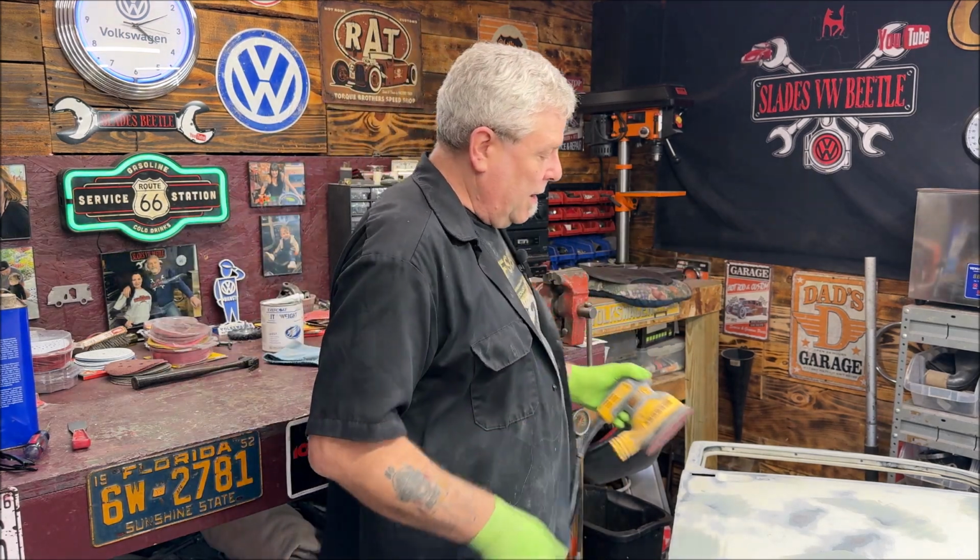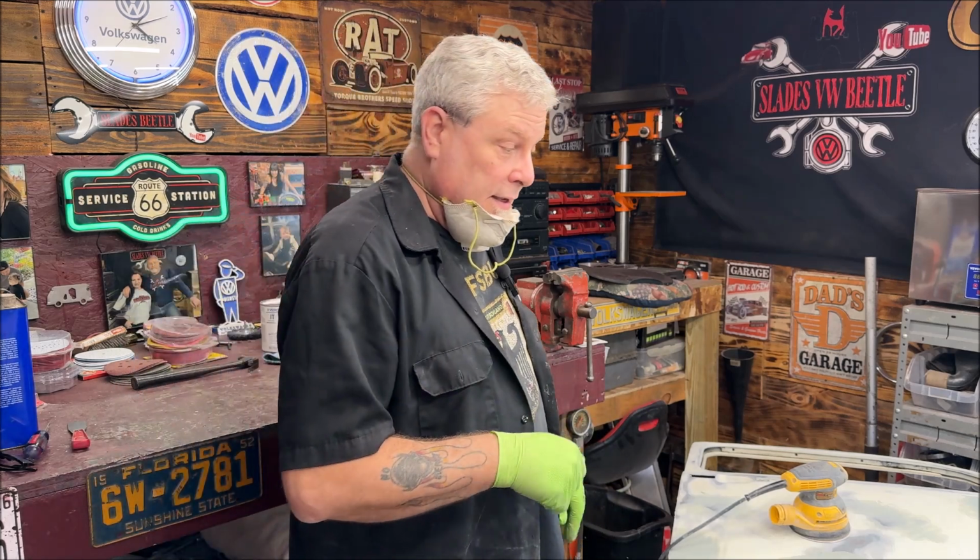All right, I got 180 on here. I'm going to try that first. Find my dust mask. There we go. And see what it does. I wanted to start heavier, but this lightweight filler seems to sand so easy that you can start out with a milder grit. So come on in and watch me. I'll put some music on.